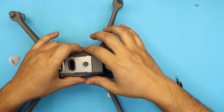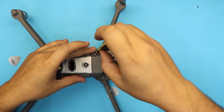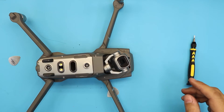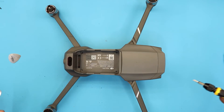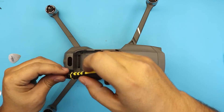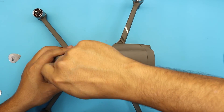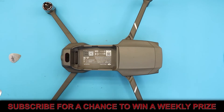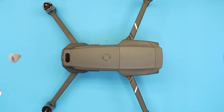Make sure you put the corner side down, then slide it toward the bottom sensor. Once it's in there, put the two screws. Put the cover for the gimbal. Then put the four screws on the top under the battery and the two at the back end. Put the battery back in and that's how you change your IMU for your DJI Mavic Pro 2.